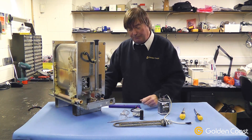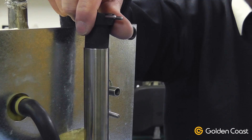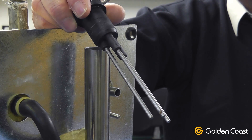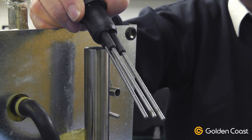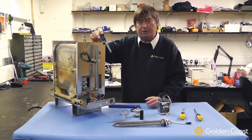This should be cleaned regularly just to make sure it's clean and tidy. Another problem is the level probes which sit at the top. As you can see, these are quite dirty and by the water droplets on them they're very greasy. The greasy film will stop them operating correctly, and they should be cleaned with a piece of emery paper to make sure you get the grease right off them.